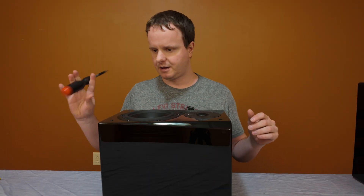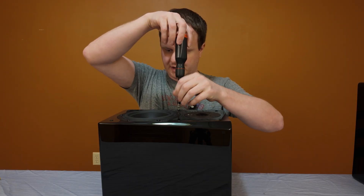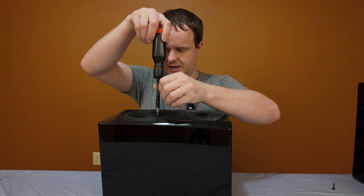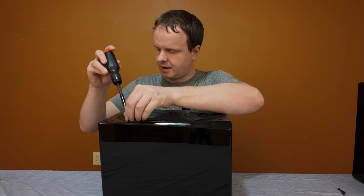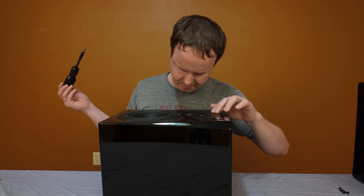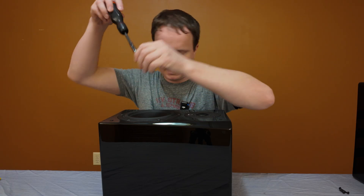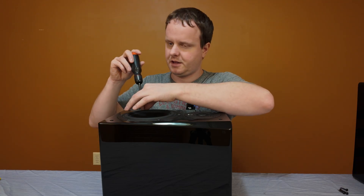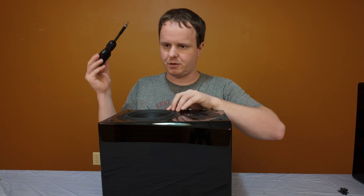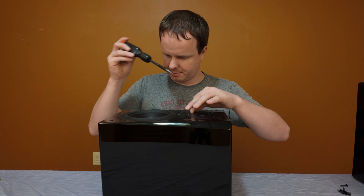I haven't taken these speakers apart yet, but I did figure out exactly which hex head tip I'm going to need to take out these screws. Fortunately, they're all the same sized hex head. One thing that's a little different is the fact that each screw looks like it's a different style of head — on the woofer the heads are rounded on the top, and on the tweeter they seem to be flat. So I will have to make sure I keep each of these screws separate. One thing I'm noticing right away is none of these screws are torqued down particularly hard; they're just kind of snug in there.